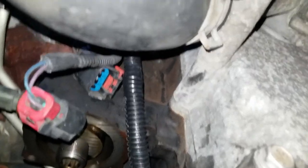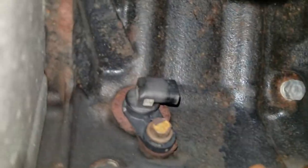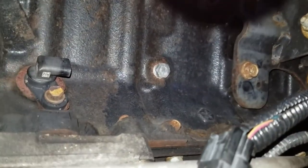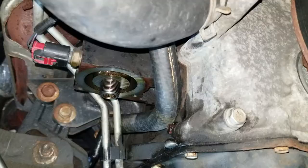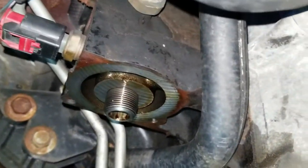I'm back under the truck now. I've gotten the harness pulled back down from above and haven't reconnected anything yet. You can see there's where it turns by the oil filter housing — it goes backwards — and I have pulled it back over here. There's the end of it, there's the crank sensor, and there's the other connector. I'm going to try to rig up a piece of heater hose or something to go around the harness where it makes that bend by the oil filter. You can see I've gotten that section of heater hose wrapped around the wire — I'm hoping that'll protect it where it makes this bend. I just split the hose so I could wrap it around the wire harness.